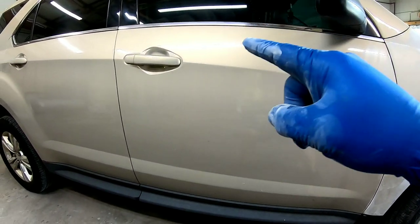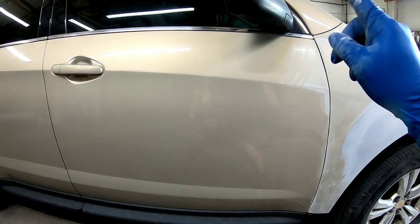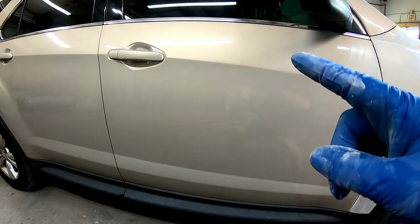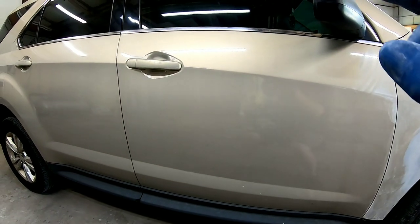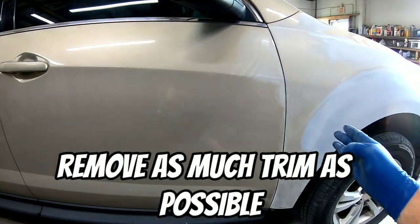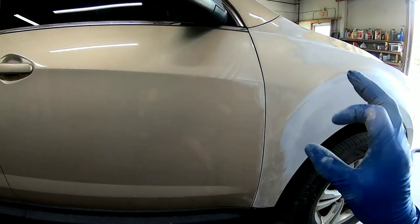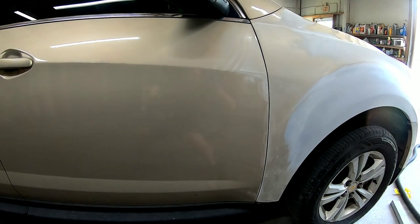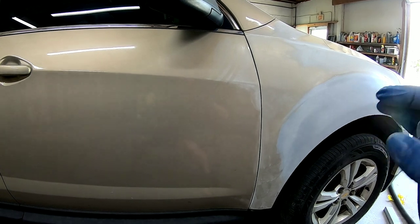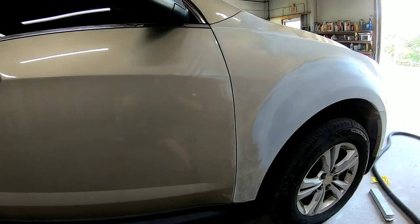I am going to remove the door handle — that's a troublesome place where clear coat likes to peel, so it's always a good idea to remove it. We may just mask off the mirror or the weather belt. We're going to be using a wet bed; this is a high metallic gold finish and the colors do not match well on these golds, so I'll need to take extra time making sure this color matches properly. Let's go ahead and get it ready for paint.